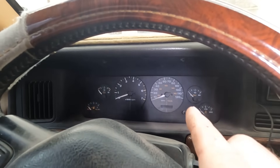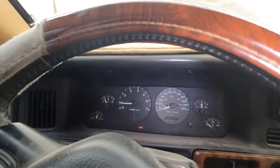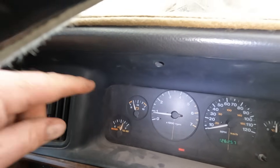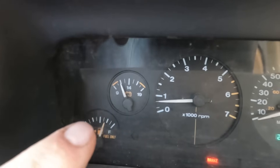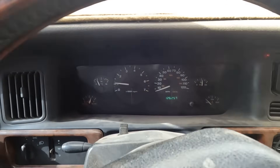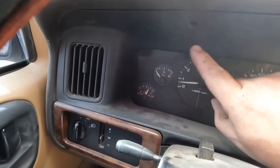Apparently my Jeep didn't really want to be charging anymore. The other day I was driving it — notice that voltmeter isn't going up at all, it's showing probably 10-ish or so. I put a plug-in voltmeter on it to see what it's actually doing, and it's got a little more but not a whole lot. Now interestingly it only shows the right voltage for a little while — pretty soon it's going to warn me that I don't have voltage and to check my gauges. There it goes. Alright, warning light 'check gauges' comes on. Voltage on the voltmeter was reading right, now drops down to nothing.